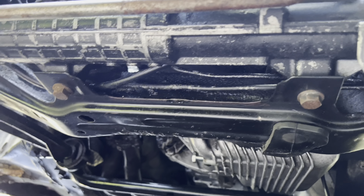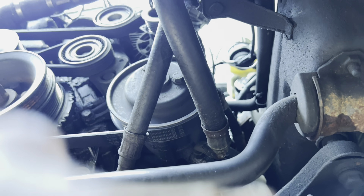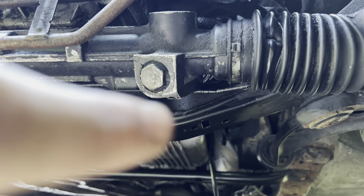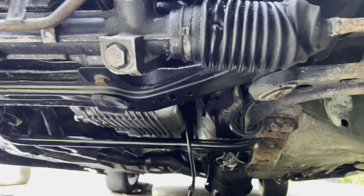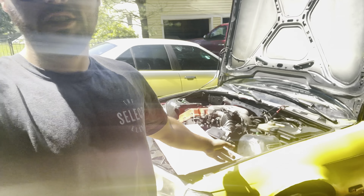It is gonna be kind of a pain because the front subframe sits right where the front of the pan sits, and also the dipstick runs all the way up and it's coming out of the pan. I'm gonna see if it pops out easily down there, but I don't want to mess up the grommet, so I might end up unbolting it from the intake and trying to sneak it down through so I don't have to deal with it leaking out of the O-ring once I replace everything else.